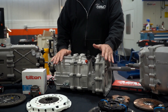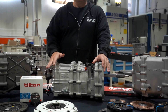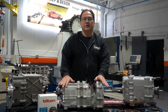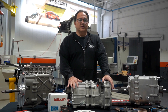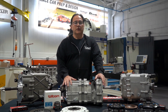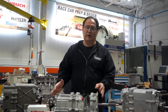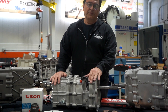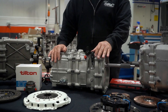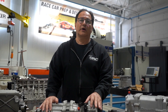We're going to call it the featured gearbox because most of the inline gearboxes that are sold are this gearbox, the DG500. The DG500 will support very nice horsepower for the S54 engines, whether you're stock or making 500 horsepower. It's not a problem. The other reason why people lean towards this is because if you ever decide to change engines and go to an S65, V8 power, this gearbox will still work.